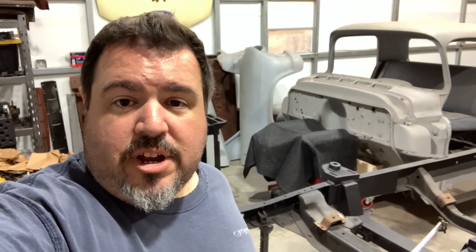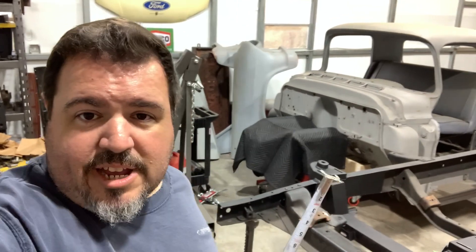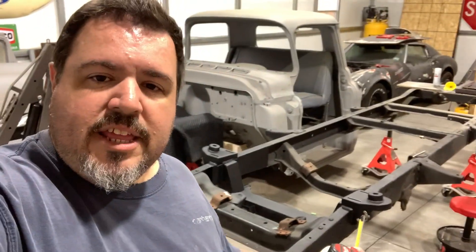If you guys remember in the last video, we installed our crossmember, got it welded along with our spring top hats, and we kind of goofed — it got off by an eighth of an inch. So I spent about a half hour measuring back and forth every single angle from each top hat to the frame, to different rivets and different areas in the truck. I've concluded that it's the driver's side that's actually a little too far back. I'm going to try today to play with these slots and see if we can get these control arms lined up and straight.